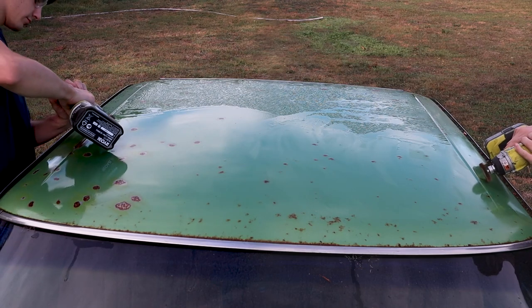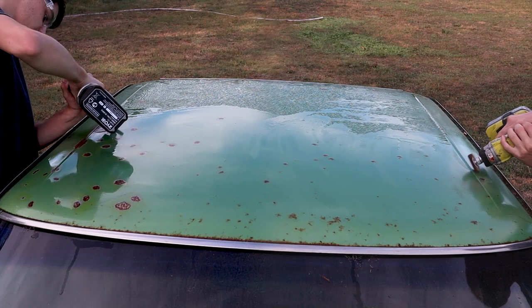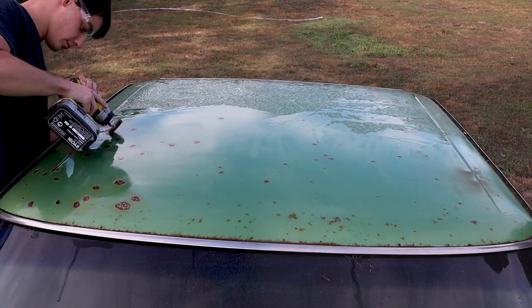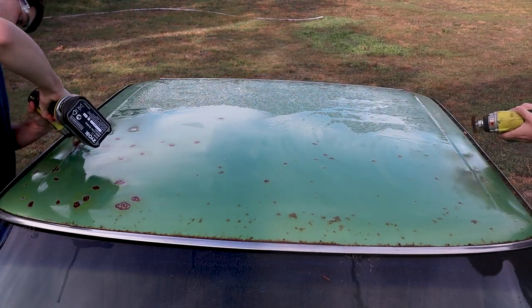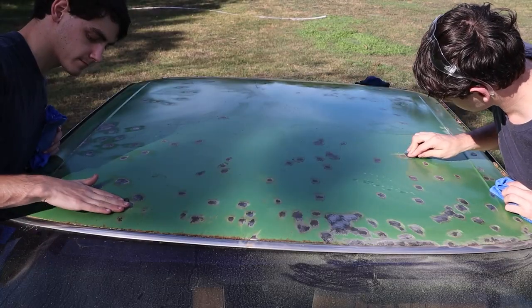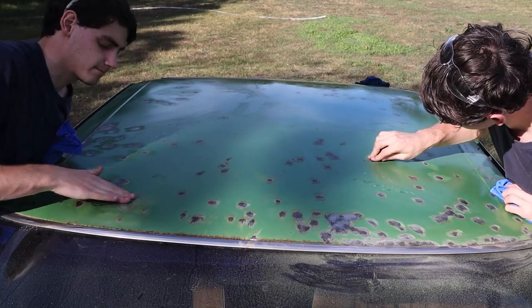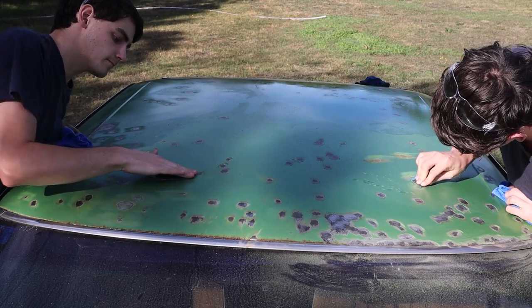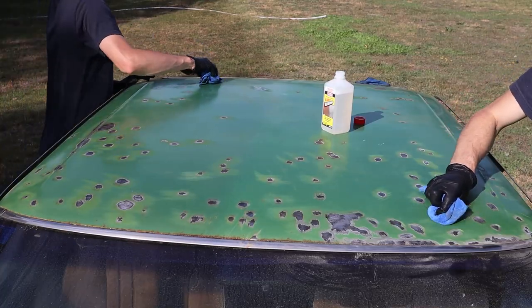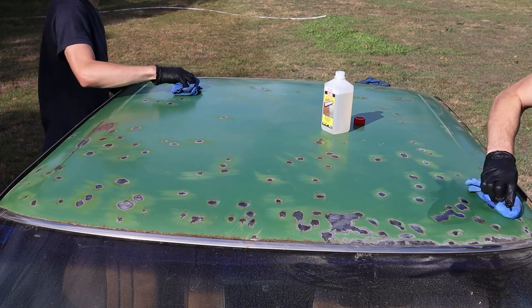It's time to tackle the roof next, and this time I used a wire wheel on a drill to take away the rust. Although it takes away the rust really fast I still wouldn't recommend doing this as it creates little divots in the panel that you either have to sand smooth or fill with body filler. However, with the help of 2nd James we removed the rust with the wire wheel and then came round and sanded it all smooth with some sandpaper. After that I gave all those little bare metal spots some rust killer just in case I missed anything.